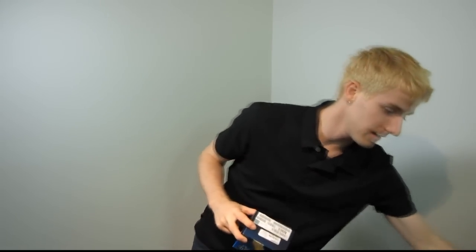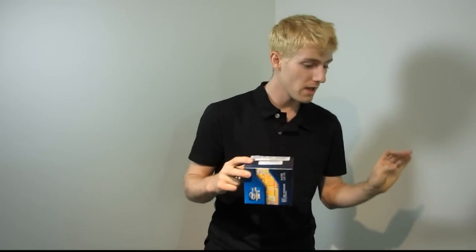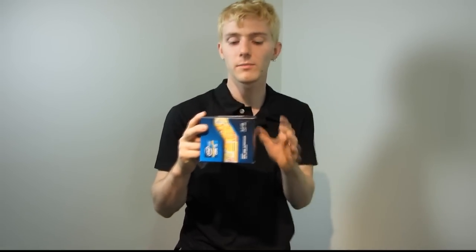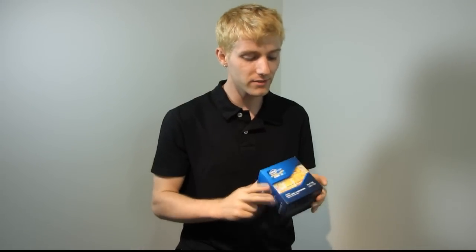The main reason for me unboxing this is actually because I want to put it up head-to-head against AMD's APU. Here I have an A8 APU, which is a four-core processor with discrete-level graphics, and then this is Intel's price-similar two-core processor, also with the highest-end Intel onboard graphics. Bear in mind, Intel CPUs have much higher performance per core than AMD's CPUs. This one does have the advantage of hyper-threading, but the A8 actually has four physical cores. I think that's going to be an interesting comparison, which I will be doing in the near future.